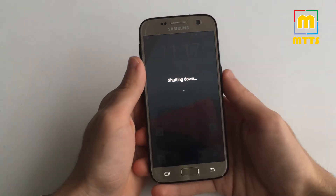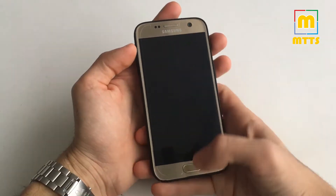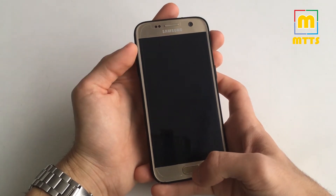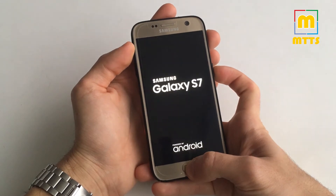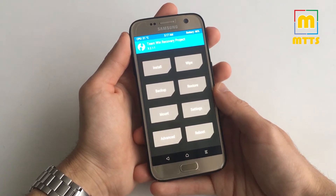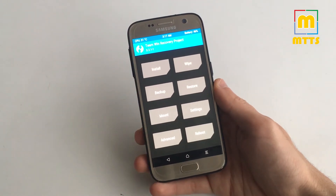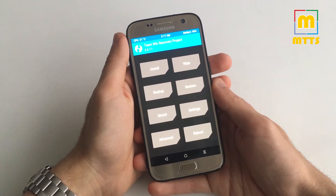Let me now just put TWRP. So what you'll need are of course a few files and TWRP recovery must be installed. The latest version is preferred. Power off the device and boot into TWRP by simply pressing volume up, home key, and power at the same time. TWRP will now be launched. The latest 3.2.1 version. So if you have an earlier version, just download it from the official TWRP site, which I'll be linking in the description.